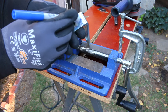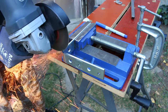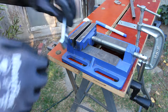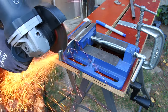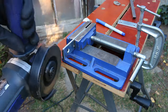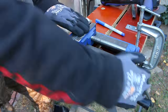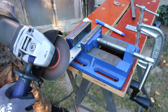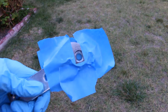I'm going to be making two arms out of one single bracket to save a little bit of money. I'm just cutting out the bend so I have two flat pieces. One caveat is that one of the arms is going to be longer than the other. My bike is already asymmetrical with a cassette on one end and a disc brake on the other. You won't have this problem if you just buy a piece of steel — I just had these laying around. If not, just get a long piece of steel and cut it to roughly these shapes.